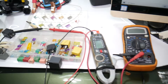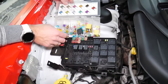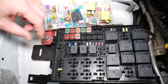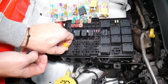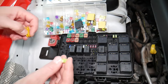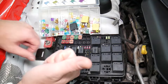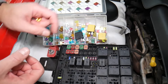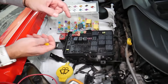Before we continue, let's quickly explain why it's always a good idea to test fuses and relays. It's very important — sometimes you may think you have a good fuse but it's hard to tell just by looking. For example, on a 20-amp fuse it can be very unclear whether it's burned or not. If you don't test the fuse, assume it's good, and move on, you could end up spending money on diagnostics for problems that don't exist. Always test your fuses, always test your relays.